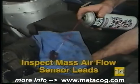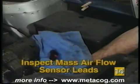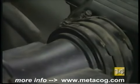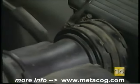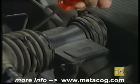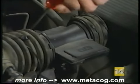Inspect the harness connector for cracks in the wires or corrosion on the connector. If found, repair any broken wires and clean any corrosion from the terminals. Loosen the clamps securing the mass airflow sensor in the air duct, located between the air cleaner and throttle body, and move the clamps down the air duct hose.